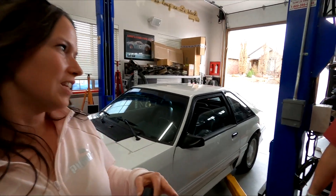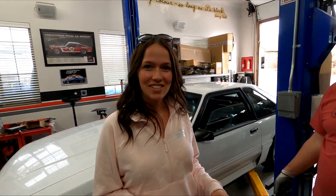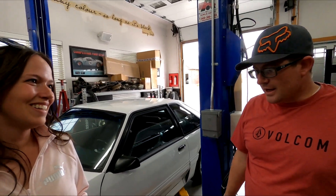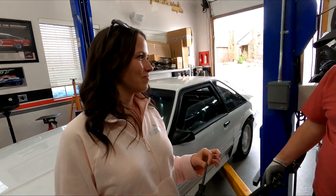As far as building this car, I kind of want to race a little bit. What should we do first? Shocks - do the rear shocks first, they are completely gone. That driver's rear side is leaking all over. And then let's double check brakes, ball joints, and tie rod ends - we'll do that real quick too.